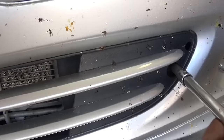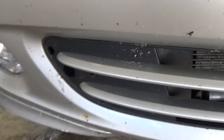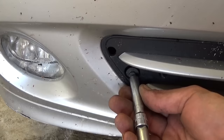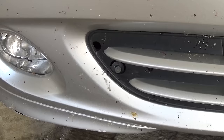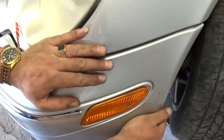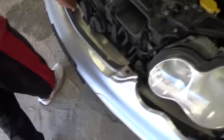Next, on the front in this hole there is another bolt with an 8mm socket that we need to take all the way off, and there is one identical to this one on the other side as well. Now we take the last bolt off.